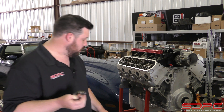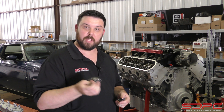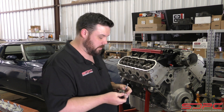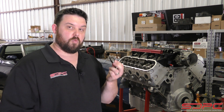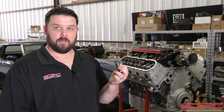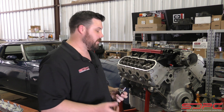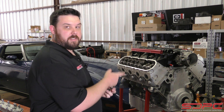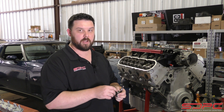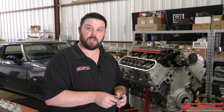The next step is to take your rocker arm with your socket. The factory bolts are 8mm; some of the aftermarket ones use an Allen key, so make sure you have the right tools. Make sure you're using the rocker arm that you're actually going to be using — if you use an aftermarket rocker arm, don't check your pushrod length with a stock rocker; that'll mess up your readings. For the same reason, I've already assembled this engine with the gaskets and the head bolts have been torqued down. You need to do the same thing — it's not really a place you want to have guesswork.